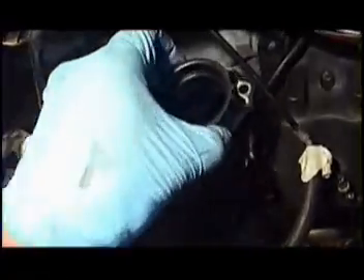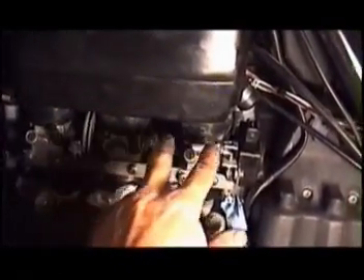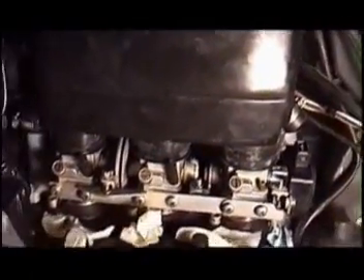Everything is correct when you're unable to rotate the boot — if it rotates easily, it's not on right. Remember that this little bump here goes on the back screw facing inside, so the little button faces out. This little tab goes on each throttle body. Here's the plenum. I left off the clamps except the ones on the bottom, and instead of using the Oetiker clamps I ground down regular clamps to make them thinner. Basically you have two choices: zip ties or Oetiker clamps — any other clamp band is too wide.